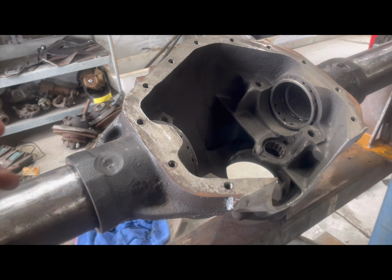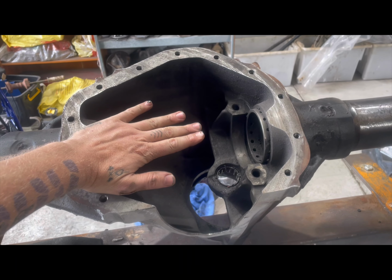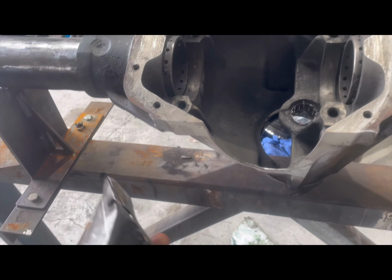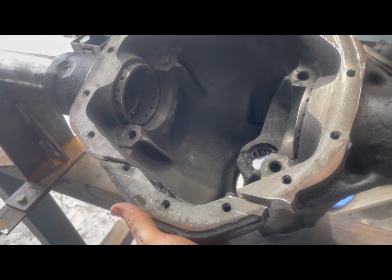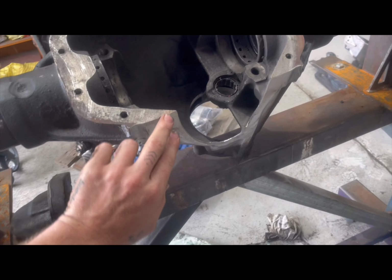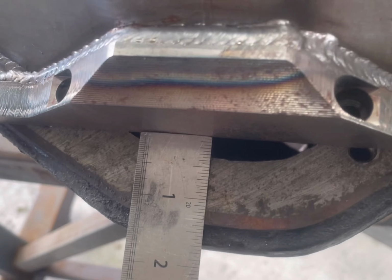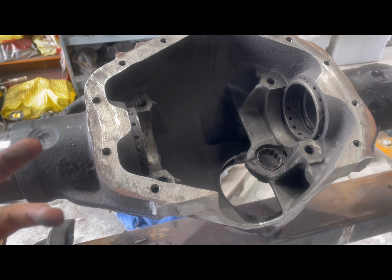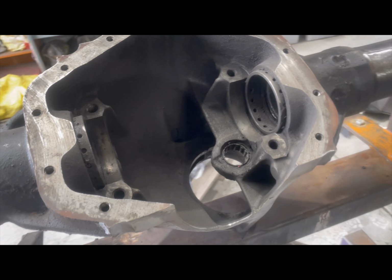Now the one downside with these 14 bolts is they're freaking huge. By huge, I mean massive. Like there's my hand, look at the size of this casing. So what you can do is a shave kit. This is how much has come off the bottom, if anything, actually possibly more. As you can see, it's a huge amount of clearance. We have a new section of plate that gets welded onto here. You gain 1.75 inches of additional clearance underneath this. This puts it on par with, say, a Patrol diff on 36s and a 14 bolt on 35s.